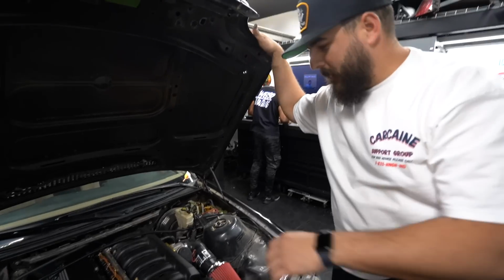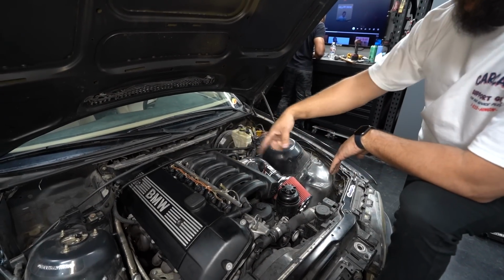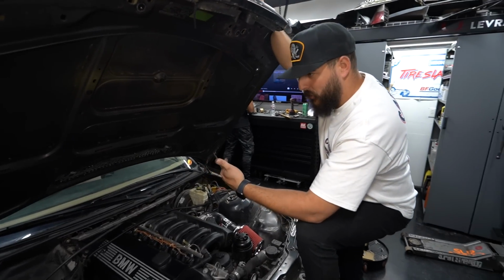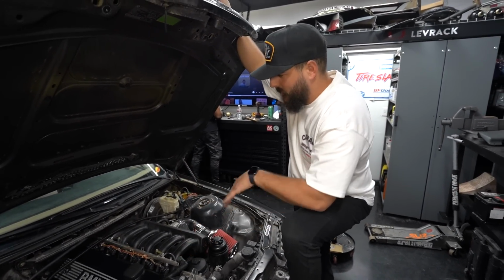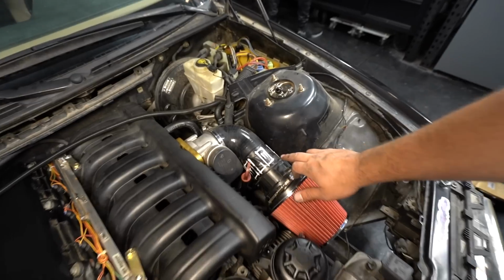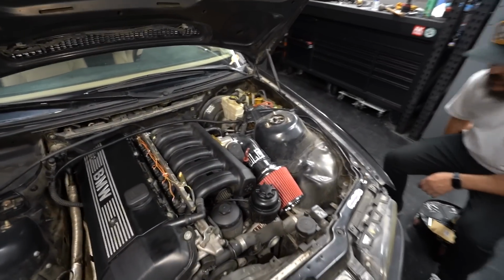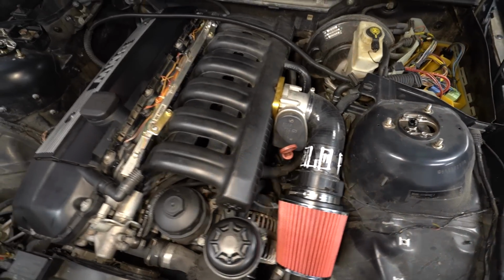All right, couple upgrades. Totally rigged this thing because nobody has a gasket in stock. So we took the intake manifold gaskets out. They're ripped on one side. Silicone the manifold, flipped them to the rip side into the silicone, clean side back to the head. Also upgrade from duct tape to Hold Fast stickers. Okay, if you don't think that's gonna seal, you're stupid. That's gonna work. So now we're gonna fire it up and see if the leaks are done, and DJ is going to bless us with maybe a tune if it runs right.